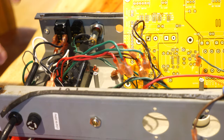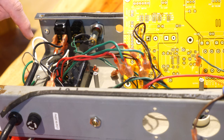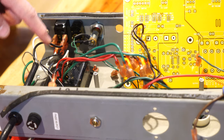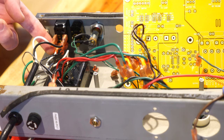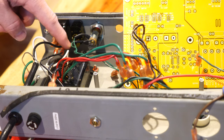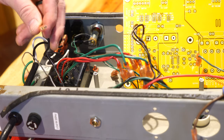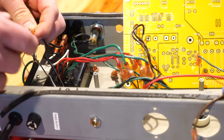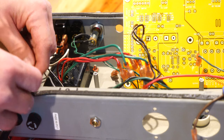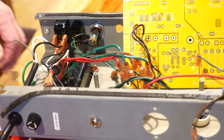Over here, the other thing that was interesting is they jumped the old board for the white and black leads, but what I've done is just taken the transformer lead for the white and plugged it into the switch, so I don't need it to go to a board. This is now correctly wired for the neutral line. The black line goes to the fuse, with the other side going into the transformer. This end cap is a little bigger than the fitting here, so I might just snip and solder both of those onto the fuse holder so they consistently look the same on both sides.